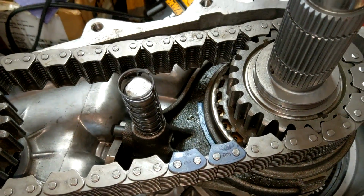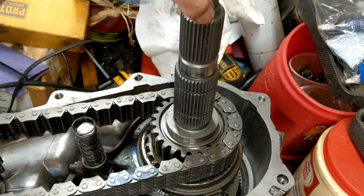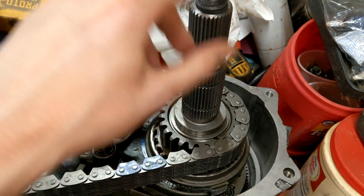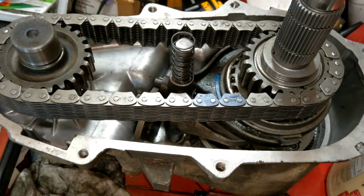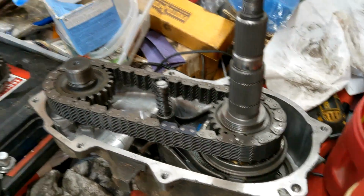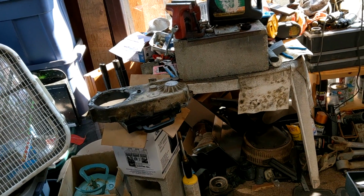Brass rings in there and everything still works fine. My assumption is that the shaft is going to get pulled forward just a little bit with the snap rings and the yoke and all that, so we'll be okay. Everything is good. Guess we put the cover on.